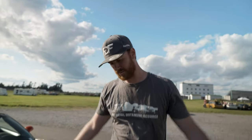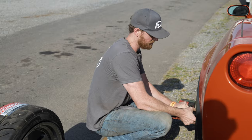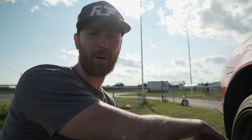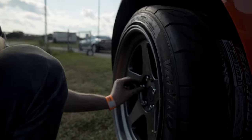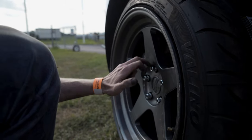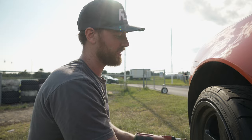We'll let you know at the end what our opinions are. We are running our extended wheel studs on our 5x114 redrilled hubs and rotors. The ARP studs have this nice little pre-start making it super easy — you could just put this in an impact and it's going to be centered every time. Super handy. We've got our Wilwood four-piston caliper and our handbrake, making this car really user-friendly for the track.